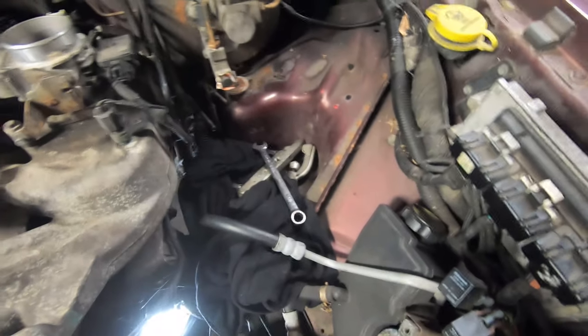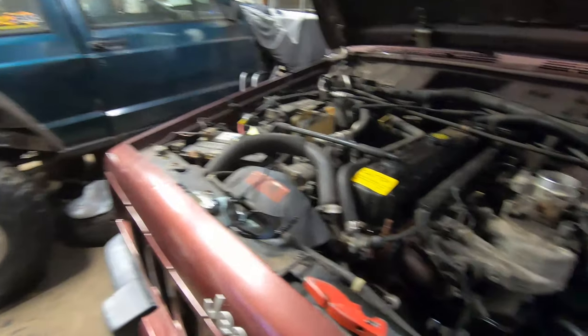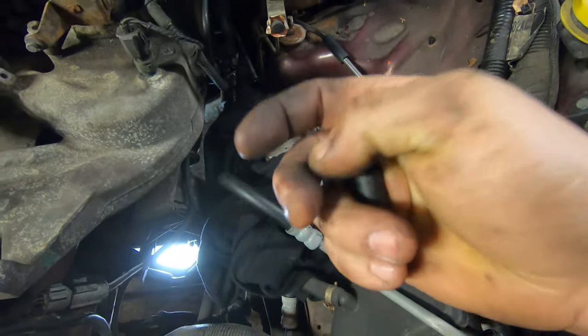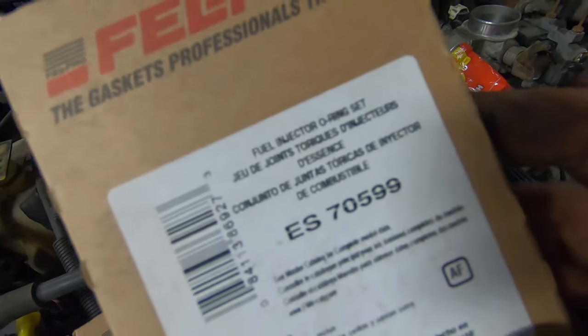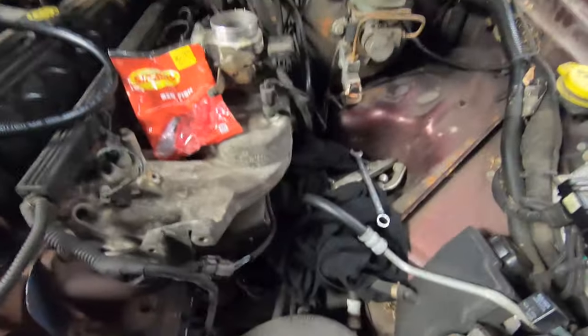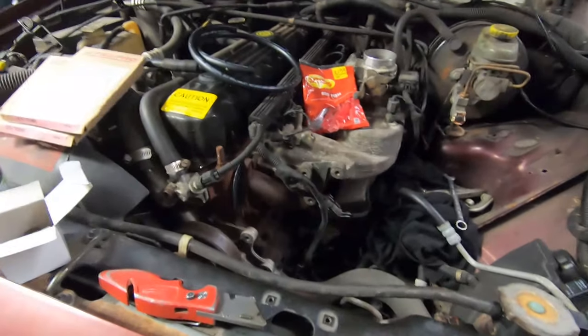So I decided to cut it off. We need this thing ready soon, and we're gonna do a quick fix. Now, soft line up to the fuel rail. And while I'm at it, I'm gonna go find some O-rings because they haven't come in yet either. With a quick trip to the hardware store for some hose clamps and fuel line, and of course some candy, and another quick trip to the auto parts store for some O-rings, we are ready to start really finishing up and getting this thing running again.